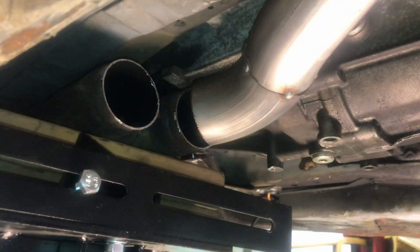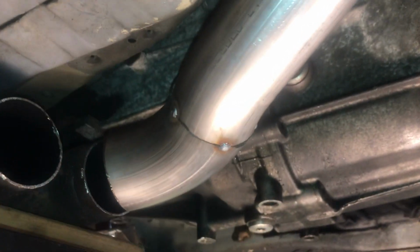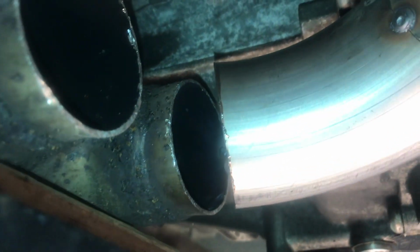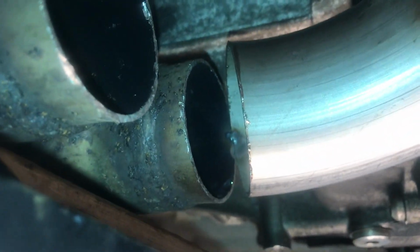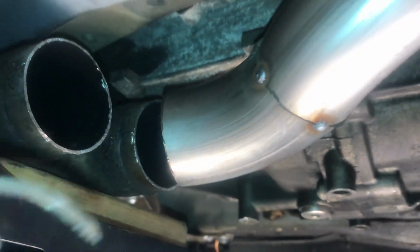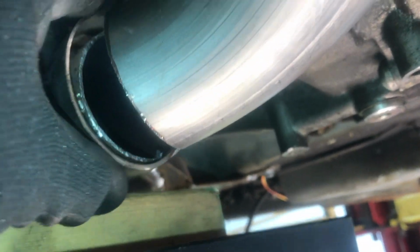Okay, self-deprecation time. This is a relatively complicated bend that I was able to use two of those pieces in order to get it fairly close. I inevitably came into a situation here where I do have a joint that's making connection on only one end of the circular connection. What I did was I created a pie piece here that basically slips right in here where it should go, and it needs to get tacked in there, but it fits actually pretty nicely. Kind of makes contact all around.